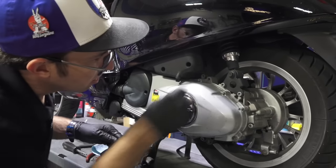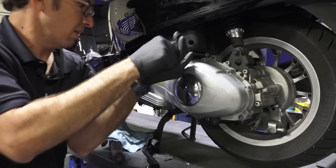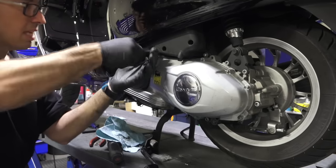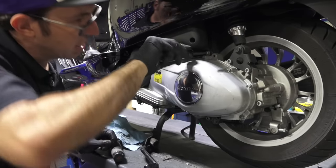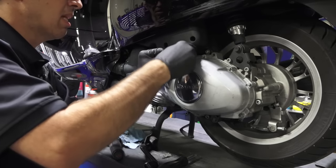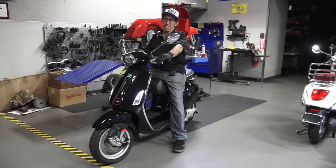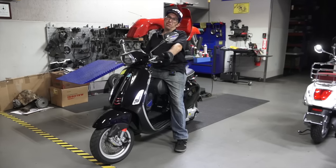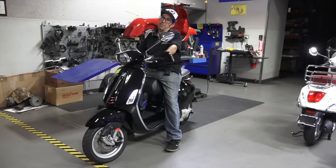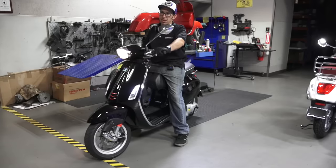Snug the air box screws — just go as snug as you can without the bit camming out. The whole idea of Phillips is it cams out, which is kind of like a torque-limiting function. Pop the little corner cover on, and you're done. Belts all installed. Sometimes they'll make a funky little noise when they first start, or slip just a little. Don't be alarmed — try riding around for a mile, and if anything feels wrong you may need to take it back apart. This one feels good — starting it up and it sounds great.